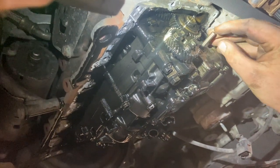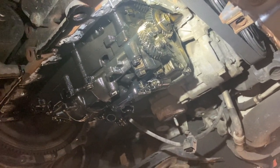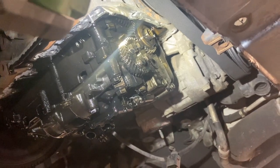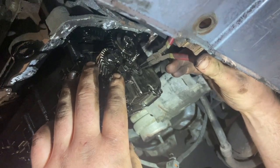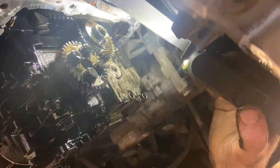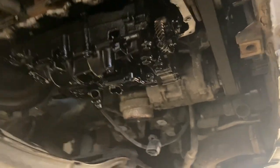Simply just slide the new rod straight into place. So these modified ones are about an inch longer, just to get a better drive on the pump, so stop some wearing and stuff. Pop the C-clip in now. If you're going to order a new drive, it's probably worth ordering a C-clip at the same time, in case you're stuck halfway through the job and lose the clip. But I just heard it click into place, so just make sure it's definitely in. That's all gone back in nicely, and everything's gone fairly well to plan so far.